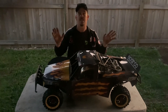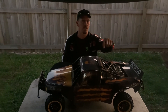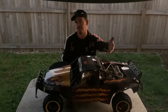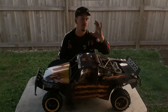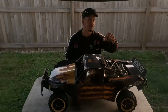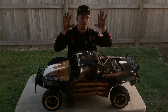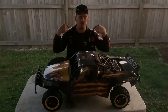I'm going to say that I'm pretty well impressed how this thing runs. The only thing that I might change is the spring tension in the clutch, because this is the 57 twin. It doesn't have the big clutch, but it's got like the 70 mil clutch I think. Steel shoes and all the rest, fully adjustable. So I do want to loosen the preload basically so it comes in a little bit earlier than what it does — you will actually hear that in the video.